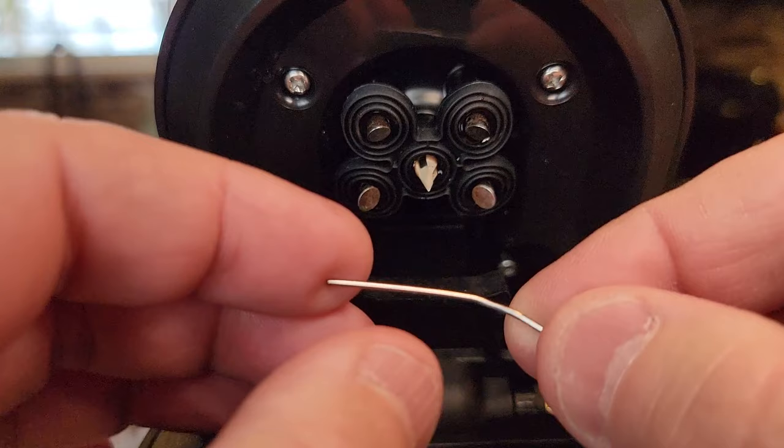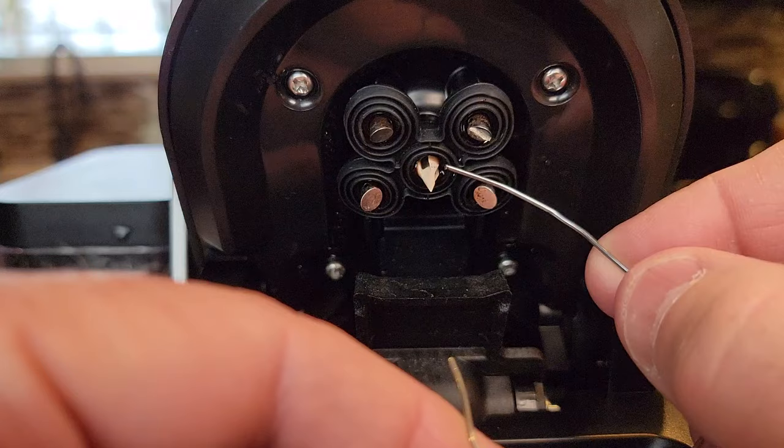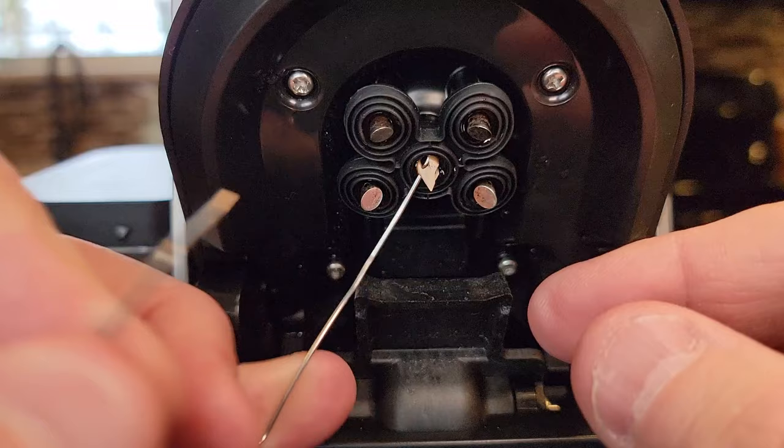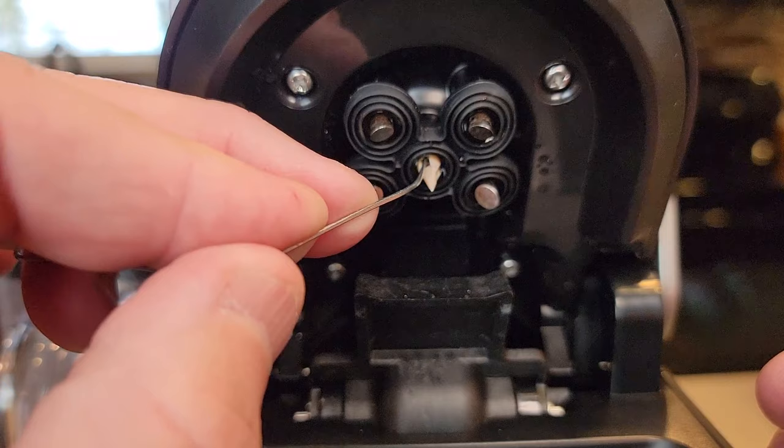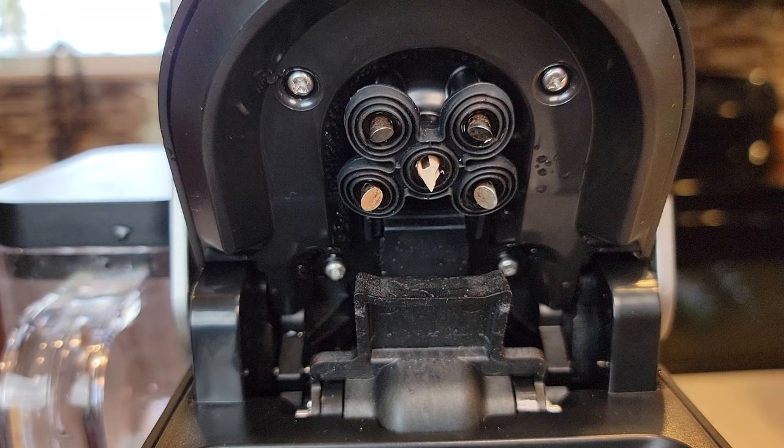Get your paper clip. We'll do the big needle first and you've got to come at an angle — you might have to bend it a little bit. See how I'm at an angle? I'm not going straight. If I try to go straight, it doesn't go in. If I come at an angle it might be easier to go the other way. There's that back one. The big ones are cleaned out. You can go up into it a little bit — that will clean out the tube — but don't go super far. That is just a plastic tube and you could poke a hole in it.